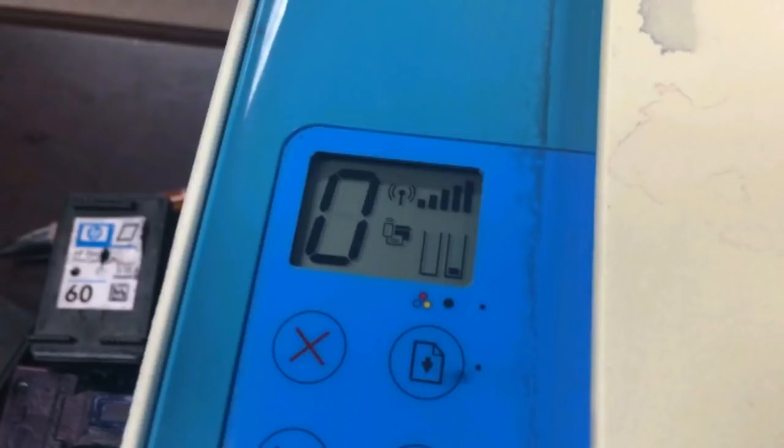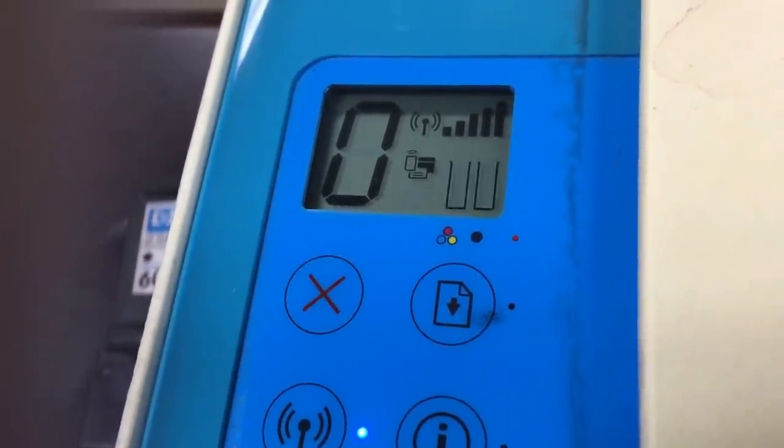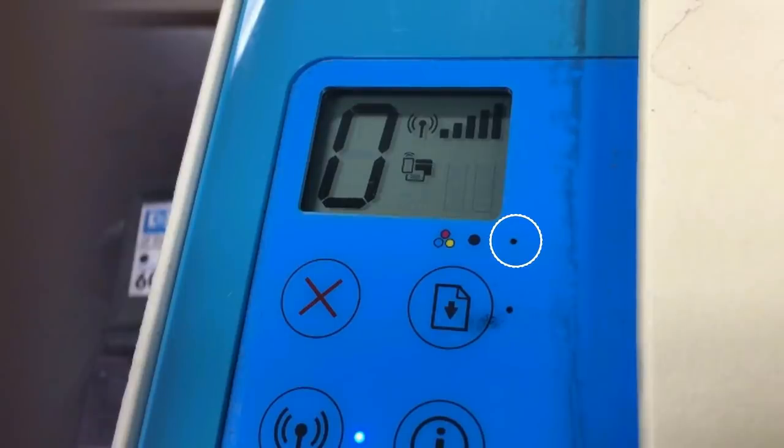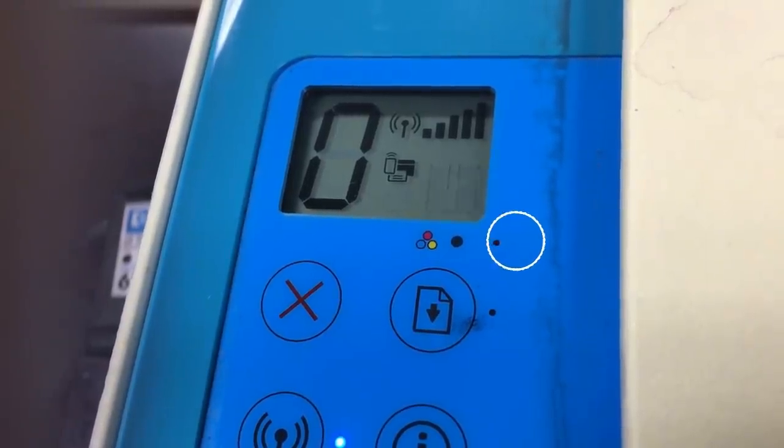You're OK as long as the ink indicator light is not flashing. When it is flashing, there's something wrong with your cartridge. Maybe you broke the filter, or maybe something as simple as ink splash on the ribbon — you need to wipe it dry, take the cartridge out, and reinsert it a couple of times. If the light is still flashing, then the cartridge is permanently damaged.